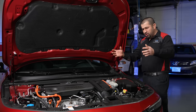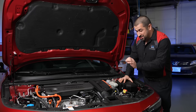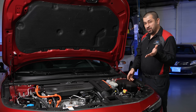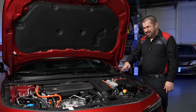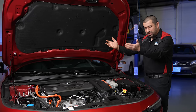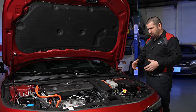Because it's a gasoline engine with a high rev limit, you can rev it up, speed up the generator motor, and generate even more as needed. When you drive, it starts in EV mode, then the engine kicks on and you hear it rev up — then seemingly downshift — in a very smooth operation. But that is not actual shifting at all; the genius of the system is that it's just revving the engine to speed up the generator motor to keep up with demand from the traction motor, while mimicking shifts so you don't feel it just droning.